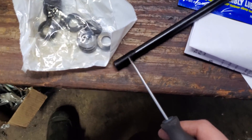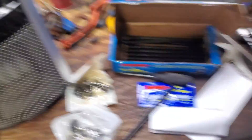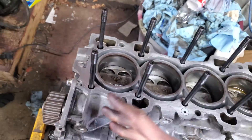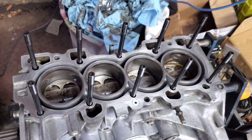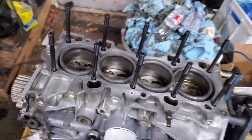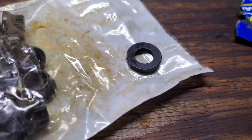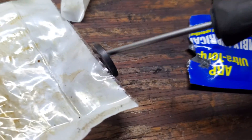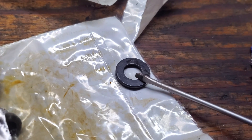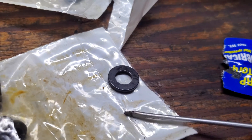Once we get that done, you're going to want to grease the threads on the top as well, and then grease the washers on both sides and under the nut head. All right, so we have our studs in. They are not torqued and they are not tight. The only reason I used the ratchet is it's bloody cold out. Now, a very good time to note: if you're doing head bolts with ARP, they will have chamfered edges on the washers. This one is completely square because we're doing studs. If you are doing bolts, you have to make sure that chamfered edge on the inner ring is facing the top. If you do it the other way around, there's a possibility you can pop the cap off the bolt — usually doesn't happen, especially with ARP.